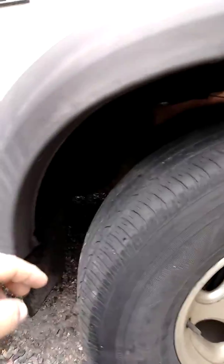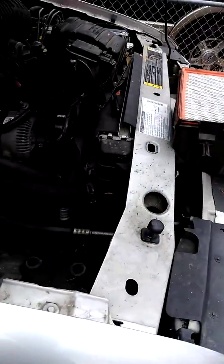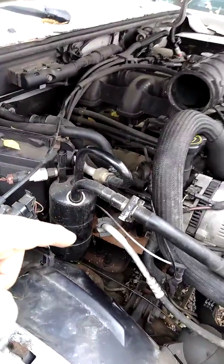After doing this, I realized there's another solution. Looking at the plastic wheel well liner, I found you could get through underneath via the wheel well. You have to take off bolts from the top - there's one, two, three - and one on each side of the trimming. Make sure you remove your tire and put the vehicle on a jack stand so it's safe. The plastic liner will pop down, and you can easily reach right in there with your hand. So I really didn't have to disconnect either of the other components.